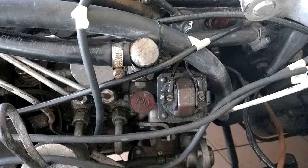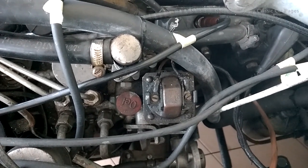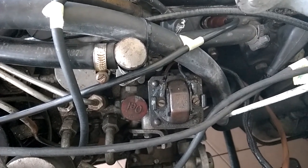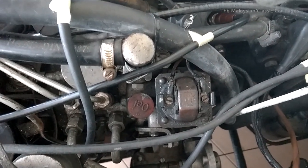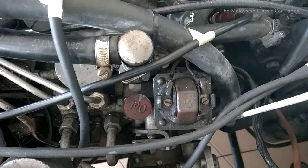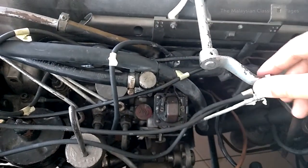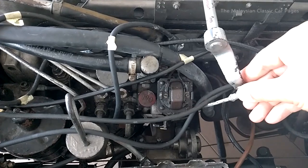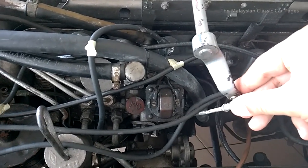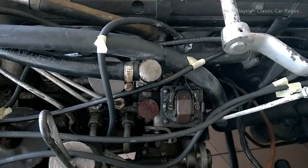It's different in two ways. One is that this is an indirect injection pump — the 300 SL Gullwing had a direct injection pump. The second major difference is how it works out how much fuel to deliver to the engine. There are two major inputs: one is this linkage here, which represents the throttle position. As you step on the accelerator pedal more and more, this lever comes down, and that helps the pump work out how much fuel is delivered to the engine.